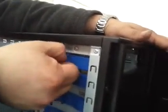So we're going to take our CD DVD player. The cool thing about this case is we're not going to have to screw in much. It's got these little holders here, so we just basically twist and pop out. Then we're going to take the DVD player, slide it in from the front, just like so, and slide that son of a gun all the way back.